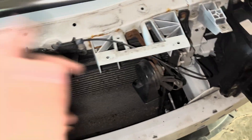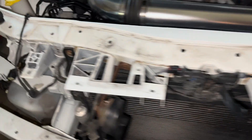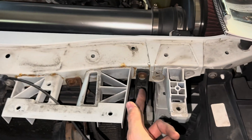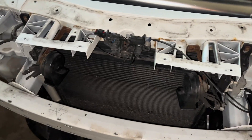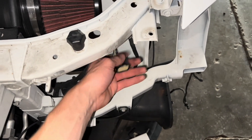They say to remove two radiator tie-downs. I'm 90% sure it's this and this right here since I'm going to have to take this off, so it makes sense these would come off. Also, something I forgot to mention: when you take out your headlights, you have to unplug them, so make sure you do that and don't just rip them off.